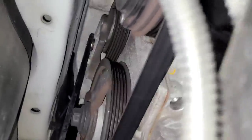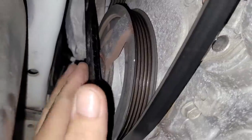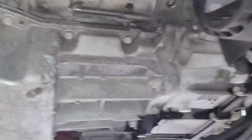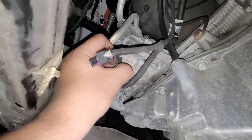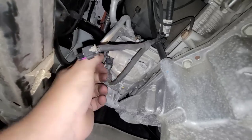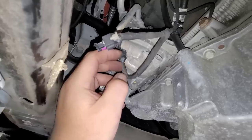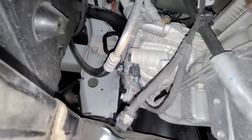Now we're going to start by pulling the belt off. I have a belt tool on here, and really all I'm going to do is jam it in between the crank bolt so I can pop the belt off and leave the belt in place without worrying about it. There was a shield underneath here that I took off yesterday — we'll be putting that back on when I'm done. Sometimes these connectors really are not fun to disconnect. I finally got it to release with just a little pocket screwdriver.